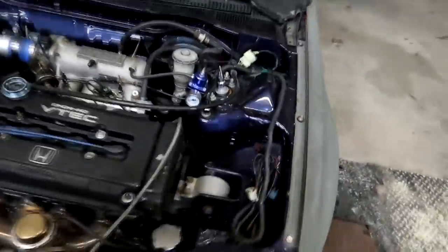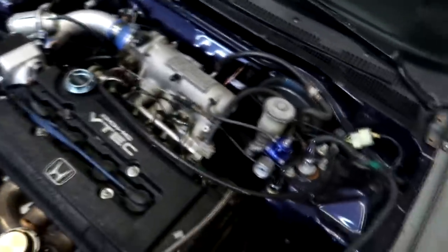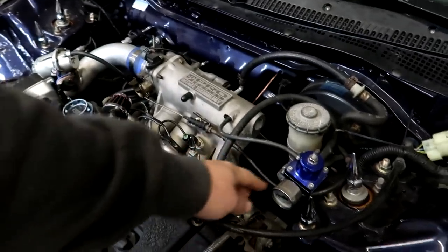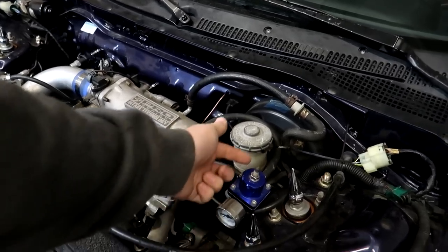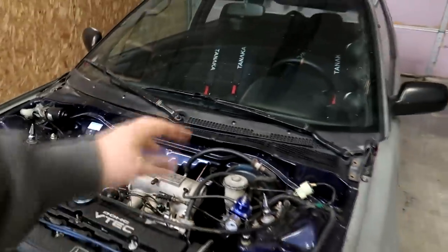When I first initially got this car, it didn't run — or it ran very poorly because the fuel pressure was actually set at 100 psi. So when I'd flip the key forward and try to start this thing, it would just spit and pop and sputter. I checked the fuel pressure and with this aftermarket fuel pressure regulator, it was set way too high. There's a spring inside that regulates how much pressure needs to open to return back to the tank, and it was just too tight. It had a set of precision 750cc injectors — old style — and they just could not open with that much pressure behind them. So I lowered the base pressure down to 40, installed some Hunter Tune injectors, and now it runs great. I did previously street tune this car.